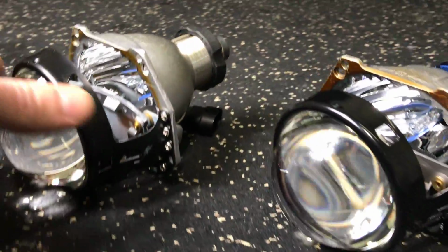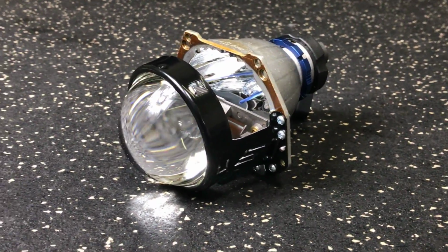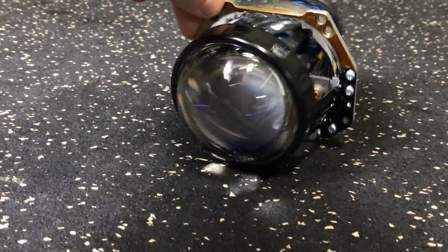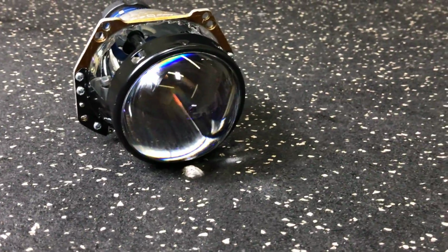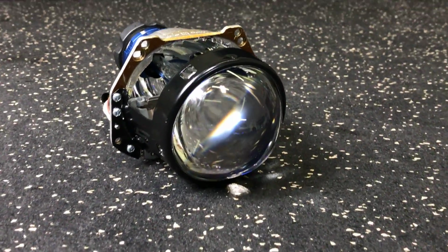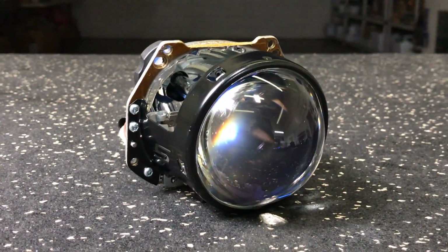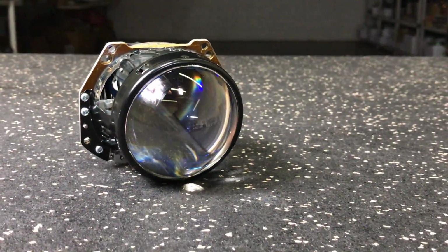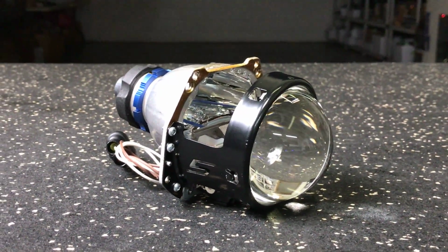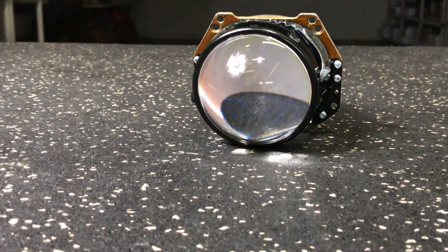We're going to talk a little bit about the 5.0 now and what differentiates it from other units on the market and from the previous projector. Back to that AR coating, anti-reflective: it actually increases optical efficiency by reducing the amount of reflections in how the light comes out of the projector. It does make a difference in performance. We tested this projector with a clear lens, and the intensity went down on the wall using our Lux meter. So it's something to consider. It's not just a gimmick, not just something that looks cool. It does actually perform better with this coated lens. We were calling it a tint before, but I think coating is the proper term for it.